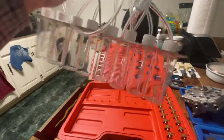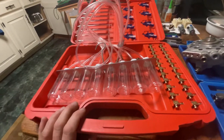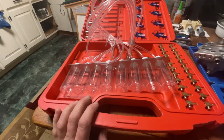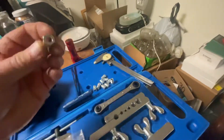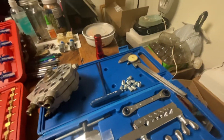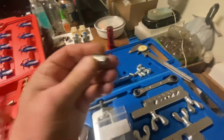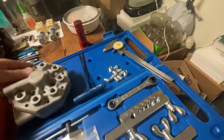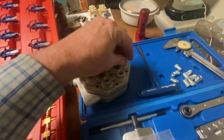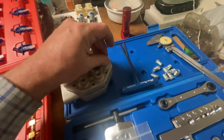You can basically monitor this — you can hang it up and untangle the tubes a bit. I'll put the Amazon link in for this. These are inverted flare fittings, M10 by 1 millimeter — they have the right length. You want them long enough to reach the bottom of this; that's important so you don't have a loose connection in there.